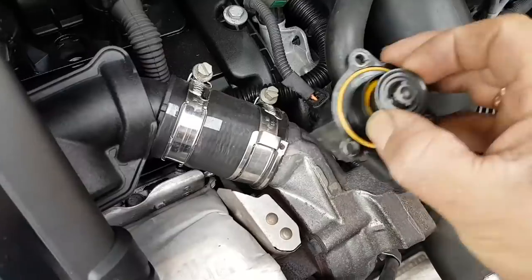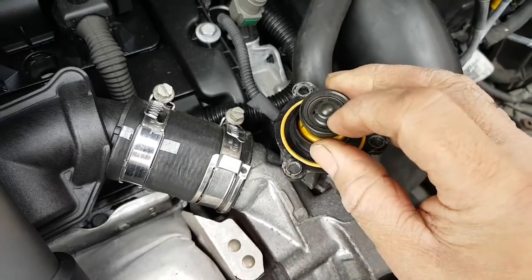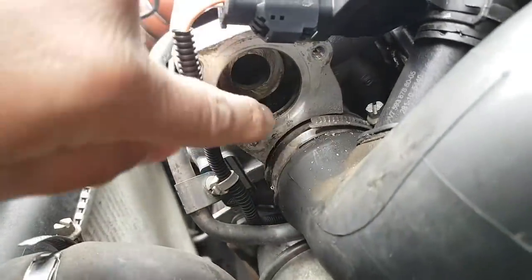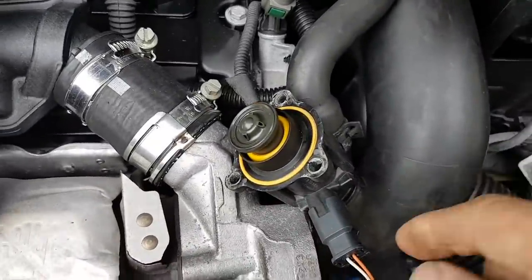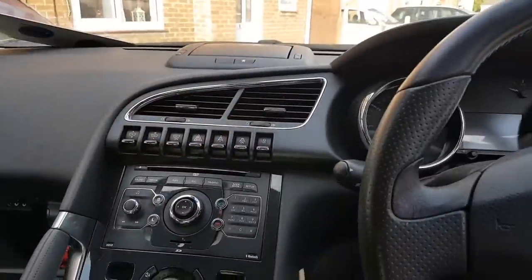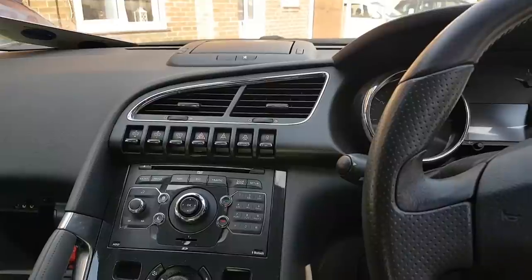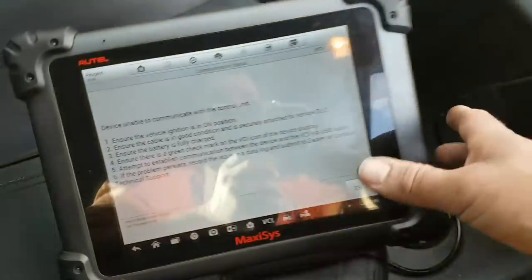The bypass valve seems to be working fine when activated. I checked the rubber seals — the yellow seal at the back and the front seal both look good with no rips or tears. I also checked the turbo actuator solenoid — the rod is moving fine, nothing obviously wrong at first glance. In the meantime I actually went for a drive.